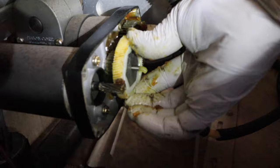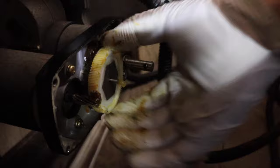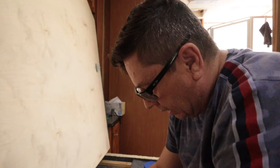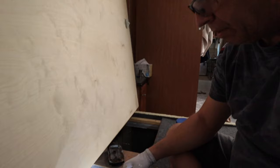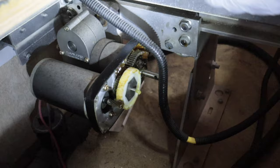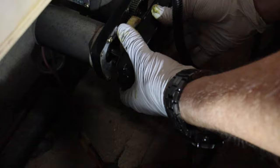This gear drives this one here, and then the secondary gear behind it drives this one — each one is probably a reduction in speed, which gives you more power. To be honest, I don't know that they should have had a nylon gear on here. If it would have all been metal it probably would have never failed, but they probably had some limited manufacturing cost concerns and didn't want to spend the extra money. That's usually how it works. Let's get the cover back on.